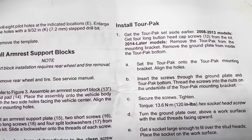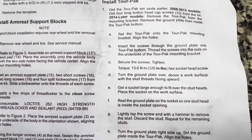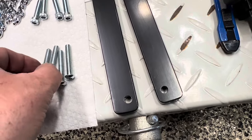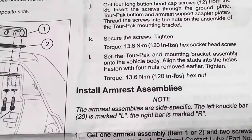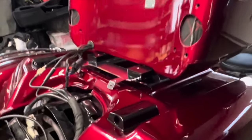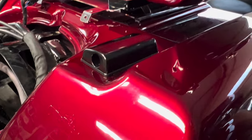The next step is actually installing your tour pack, because of course you had to take it off. In my case I'm not going to have to do this. They actually give you two bars — two holes on each side, so a total of four screws. You have to tap the studs out and basically you're spacing the tour pack up a little bit, and that happens right before installing the armrest. But in my case I do have the tour pack on already, and the spacers aren't needed because I have a DK Customs tour pack relocation kit that already spaces it up. So in my case I'm ready to install the armrests.